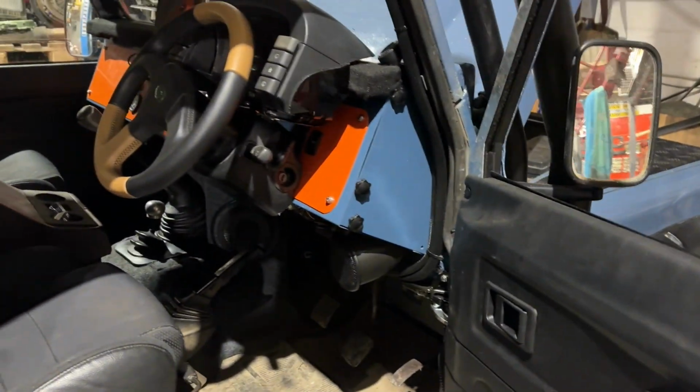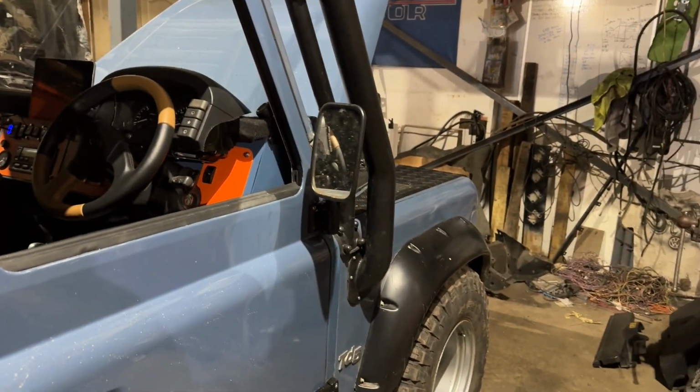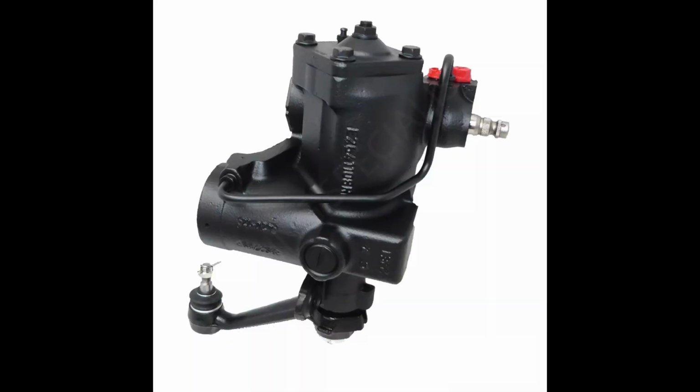And yeah, we just got to decide what we're doing with the steering box. I found a couple of how-to videos on how to rebuild them. So I'll go home and watch those and decide whether to buy a seal kit and fix this one, or a new one is just under 400 quid. Originally, the steering box on these has an external pipe that comes out the top, round and down to the bottom. Originally that was all going to be built into the casting, and for whatever reason it didn't happen, so they had to put an extra pipe in.